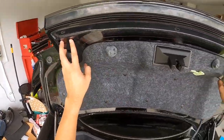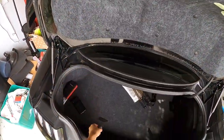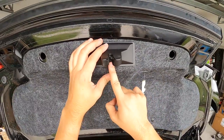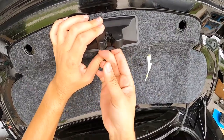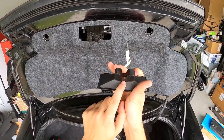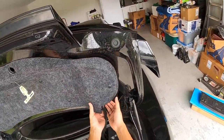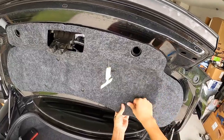On the inside there are four screws right there. I think we have to take off this piece here — let's go ahead and do that just in case. Now to get this guy off, there's a little tab on the inside — you have to push down on it and as you push down it'll unclip from that little tab and pop right out. Don't try to force it or you'll break the plastic. For the little push pins, just get behind them and pull straight out.